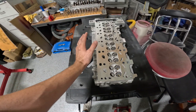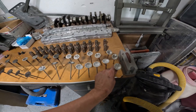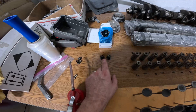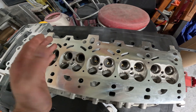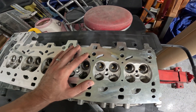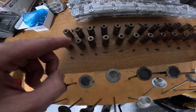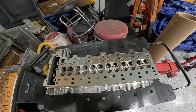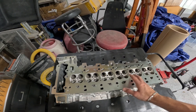You guys can watch my other video where I disassembled my built motor that had over 10k miles — the skirt coating on the pistons was literally brand new. For the cylinder head I'm going to do something very simple like I usually do: clean out my intake and exhaust ports, clear them of carbon, pull all my valves out. I do install brand new valve stem seals and check every single valve guide. I will be using just the OEM valve springs. I'm not trying to break records — just trying to build a motor that's going to run good and put out decent numbers.